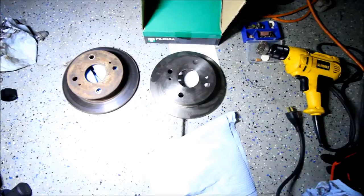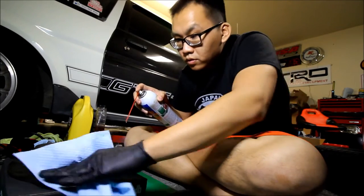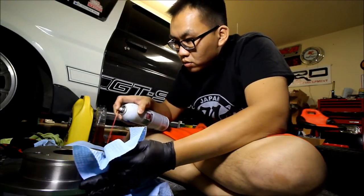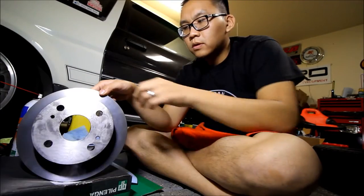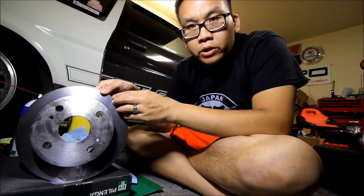I'm back — it's actually been a couple of hours, it's later on in the evening now. We're going to start off where we left off. I'm going to be cleaning the brake rotors of the coating that's on them and then we'll just pop them on. It's really important that you clean the brake pad surfaces with brake parts cleaner or acetone before installing.